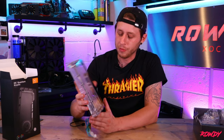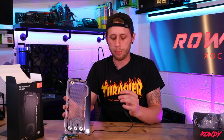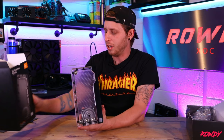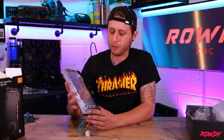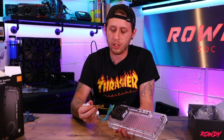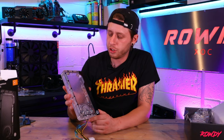This is RGB as well — the RGB strip runs at the side of the black fascia on the side here. It's 3-pin RGB, so it's 5V, compatible with most motherboards and cases these days, and it is EK-DRGB. So you can use this on pretty much most builds. On the DDC in particular, it is PWM — it's powered with 2-pin molex, which is the yellow and black cable, and then for PWM support that is just a 2-pin PWM that goes into a normal header.